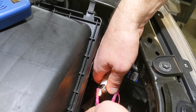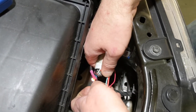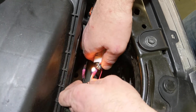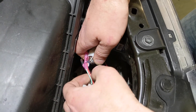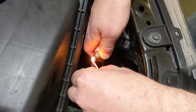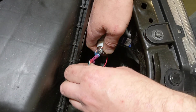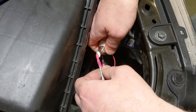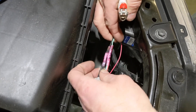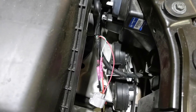Just take your lighter — you can use a lighter or a heat gun, anything that gets these nice and warm. A heat gun is ideal to use, but we'll make do. There you go — you can see they've sealed up. So now you've got a waterproof connection that will last more than the month or so that those little T-taps throw.